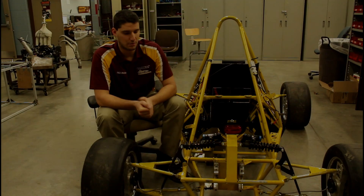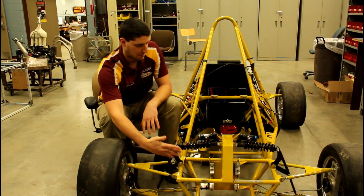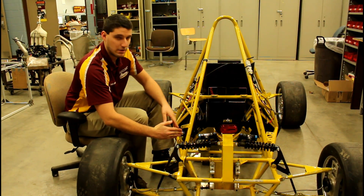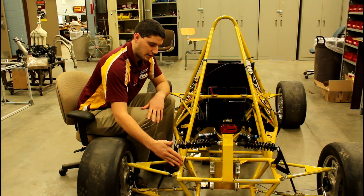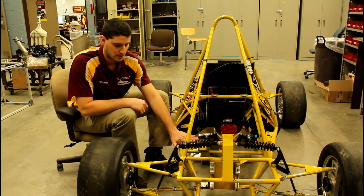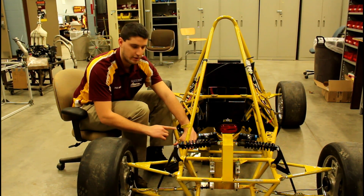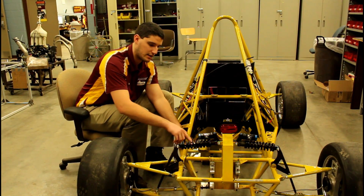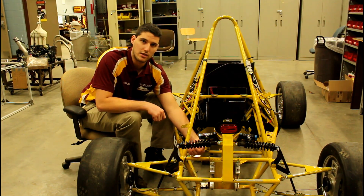Generally, what's changing with the suspension system is that this is all up and down in one plane, parallel to a bunch of planes during the chassis. Our new cantilever is actually going to be mounted on an oblique plane farther up here on an angle, so the motion of the tire will be going up and it's going to push the cantilever backwards. Our shock is then mounted to the back of the frame, and it will be pushed backwards, compressing the shock this way.